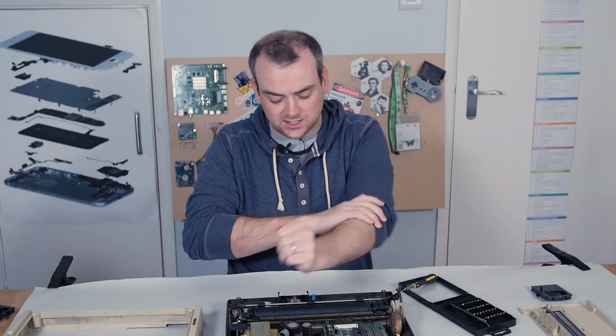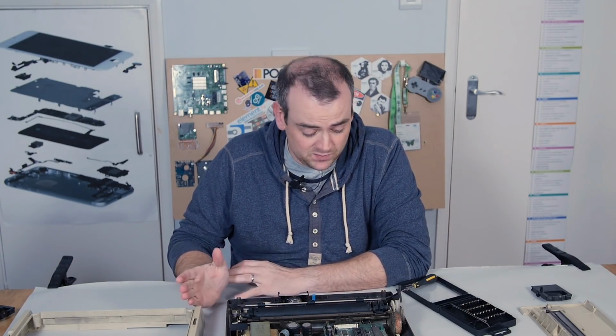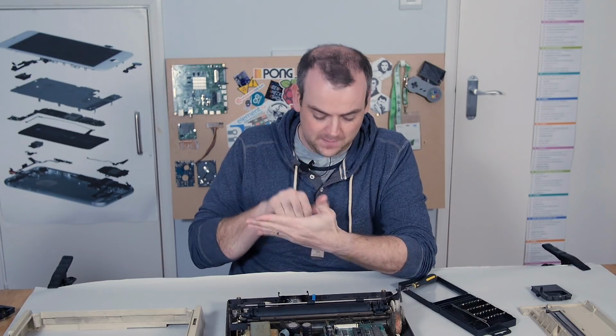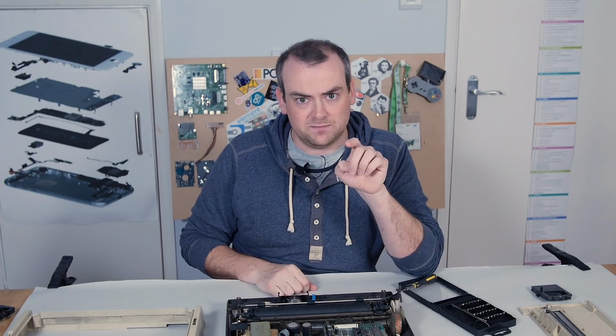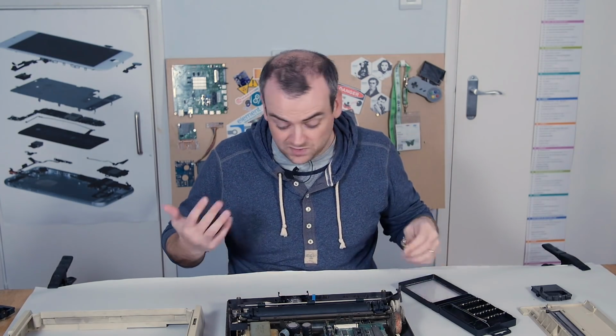So yeah, this type of printer, dot matrices, fall into a class of printer known as an impact printer. And the name is pretty much exactly what it sounds like. These are printers where they impact the paper and the ink and medium to get the font up. Now with a dot matrix, that's obviously made up of dots like pixels in a picture, but they can only be black or white. But they can at least reproduce dithering effects and bitmaps and things like that.